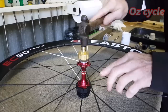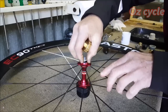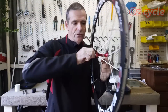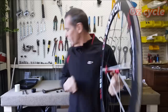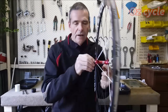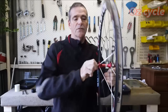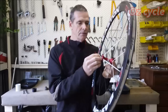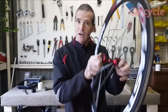All done. Now that you've got your bearings in on both sides, feel that it's nice and smooth with no sideways movement. If it's a little bit rough, it could be that you pressed the bearings in really tight — just get a small hammer and tap gently and you'll feel it free up. There should still be no movement. Once you're happy, put your dust caps on — they slide on quite nicely now we've cleaned everything up. Don't forget to put your little grub screws back in — and all done for the front wheel.